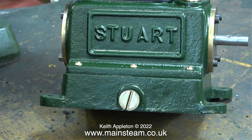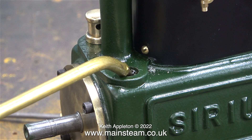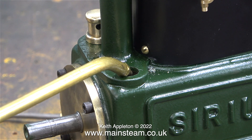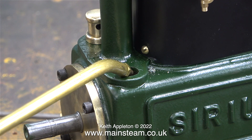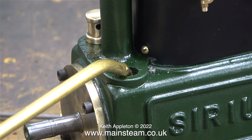I refitted the plug to stop oil running out of the sump — cleaned it up and polished it so it looked better. Once the drain plug was fitted I filled the crankcase with oil, not right to the top; there's a dipstick that shows how much oil to put in, just like on a car. That's it for this episode — in the next one I'll modify the flywheel, complete the assembly, and run the engine. Stay safe, stay healthy, thanks for watching.